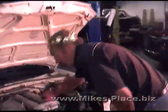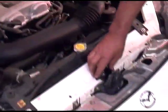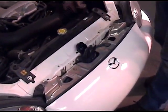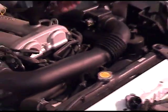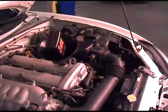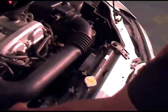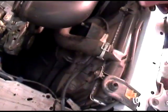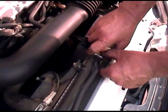Now the car is coming down off the lift. We're taking the oil cap off — real important — and placing it right here where the hood latch is, because you can't close the hood until you put the oil cap back on. So now we'll pour in our four quarts of oil. Before we open the radiator, let's check the pressure. Not a lot of pressure — the hose doesn't have real tension — so we can take that cap off. Always be careful and be ready to put it back down. Plenty of fluid in the radiator.